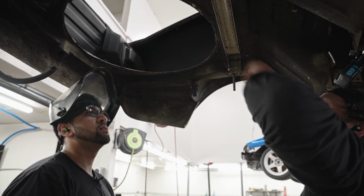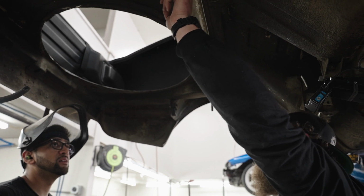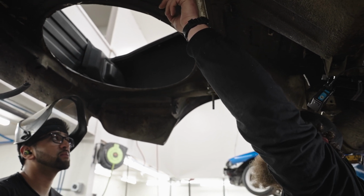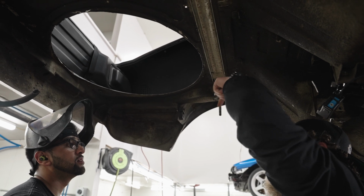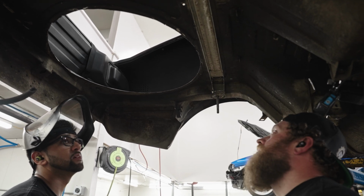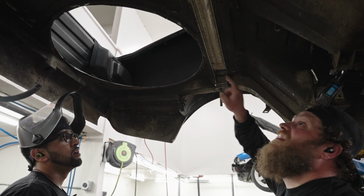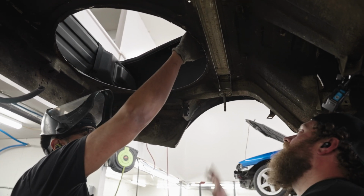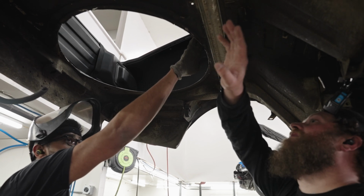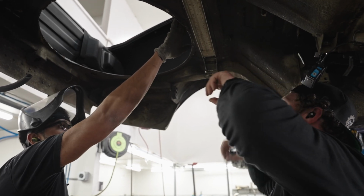So what I would do is put the bar as close to the floor being flat as possible. And then on the top, just drill holes through the floor and tack weld into it from the top, yeah. Because really, it's not for the floor, it's for the two frame rails. No, it's for the floor. No, but I'm saying structural wise, the tube is only to keep these two from twisting. Yeah, the floor is extra.